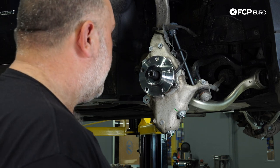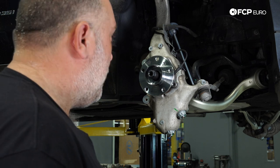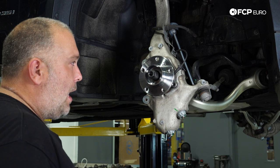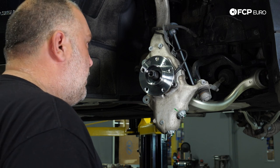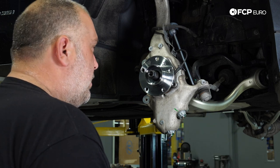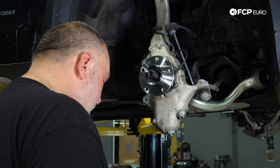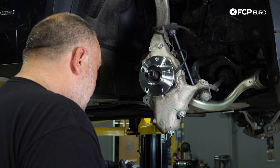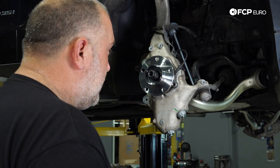Still going to use the axle puller to pull the axle all the way through. It's worth mentioning: when you're installing these bolts, they're one-time use only and all torque angled, so when you buy the wheel bearing there'll be a recommendation to also buy the bolts. There are two style bolts: M12 by 1.5 and M12 by 1.25 — they have two different torque specifications, and different bearings use different sizes. BMW decided to switch the bolt size at some point. In this case, the SKF bearing is using the M12 by 1.5. For now we're just going to get the bolts in hand tight.